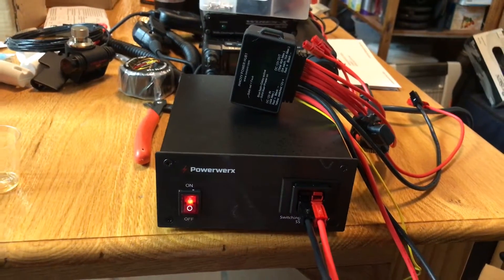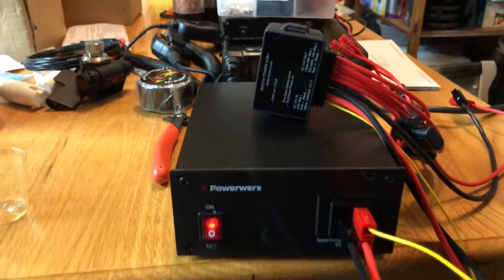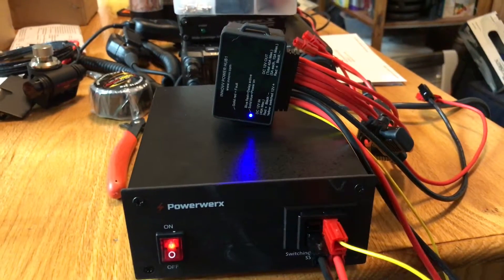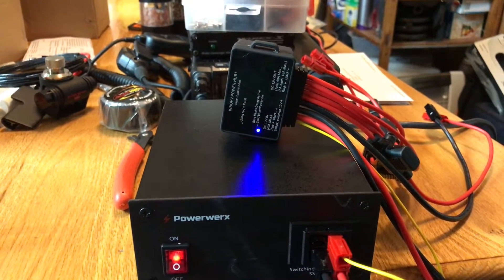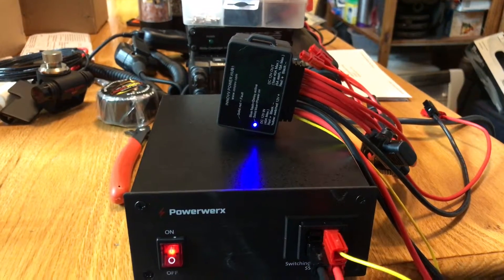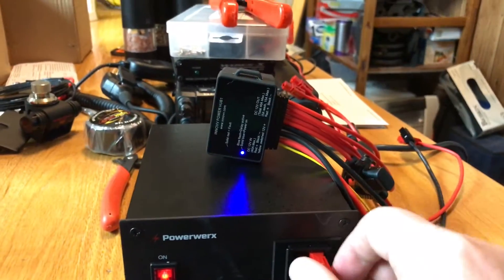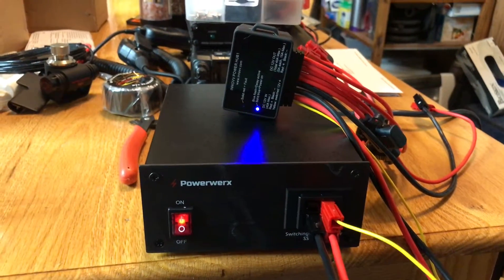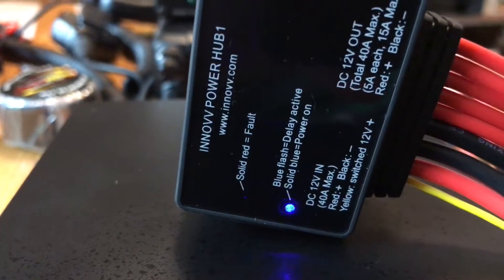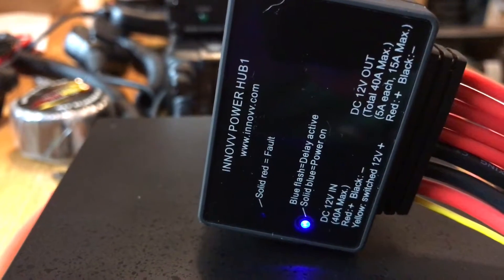Come back the next day and say, I'm going to start up my bike now. And there it is — click, and it's on. Once again we have the radio spike the voltage real quick — spike, unspike — listening for that click. No click. It stays on constantly.